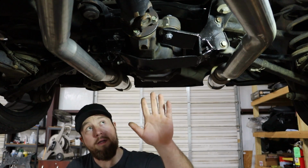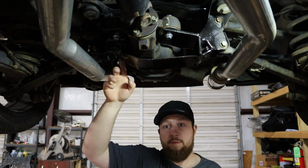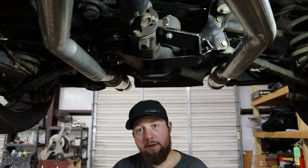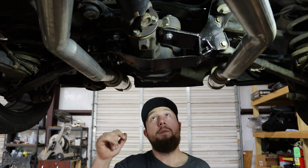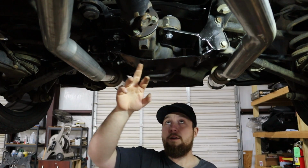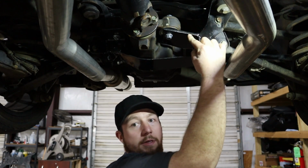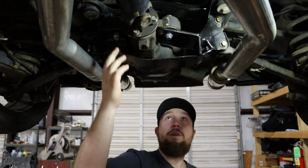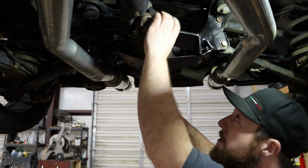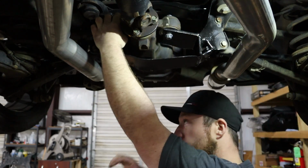What we also did is, here was the original brace from the cross member, because the Quattro had already a rear differential in here, but I cut that out and made that brace under here. I welded big plates in here, you see this and this, so this is pretty beefy. And screwed the differential on there, basically.